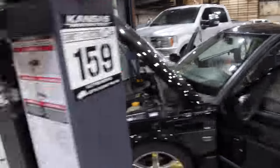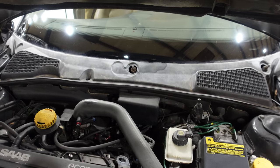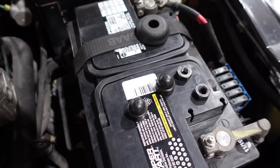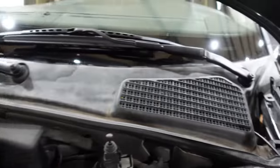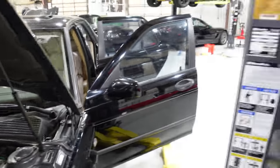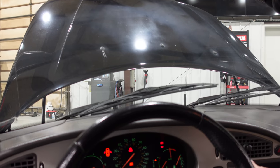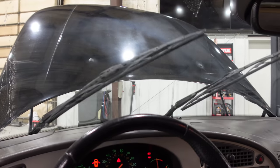The wipers on the Saab have this hardware - there's a rubber piece that's supposed to hide the connection to the wiper arm, so that sits on there like that. Then the wiper arm just drops on like they always do. Tighten the nut down and there's a plastic cap to cover the whole thing up. A 17-millimeter tightens down the nuts on the wiper arms. I just put them about where I thought they looked like they were parked correctly. Now if it's all clocked correctly we'll do a quick function test. High speed wipers - ah ha, perfect! Oh it sure sprays. All three sprayers - so cool it has three sprayers.